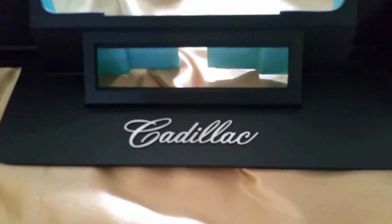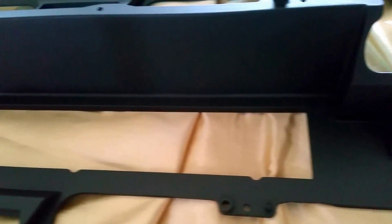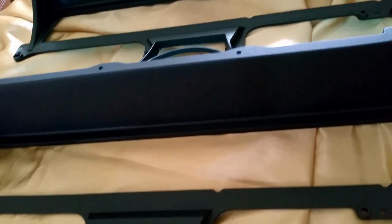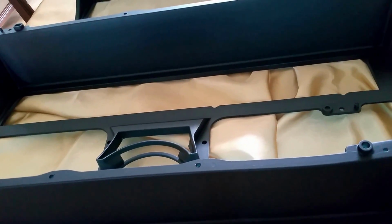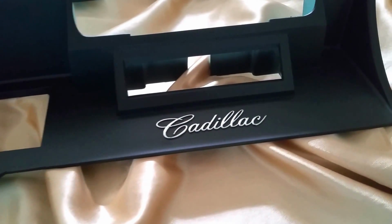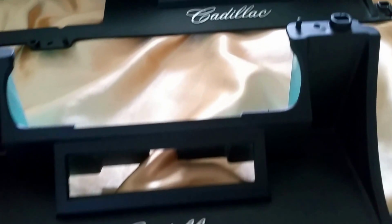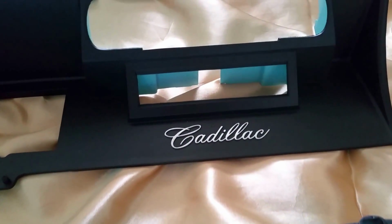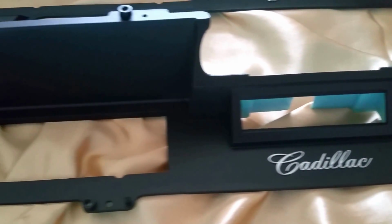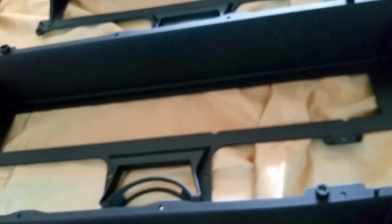Bruce had shipped me his instrument cluster for a restoration, and it arrived shattered and broken by UPS, which is a common problem with these extremely delicate products. So in trying to find alternative instrument clusters with alternative plastic parts still intact, all the other ones that I wound up receiving were also busted. So this left me with no choice but to create molds for each of the individual critical areas that were generally broken and or missing.